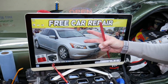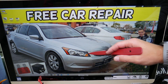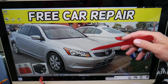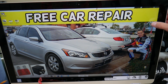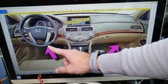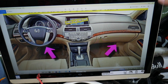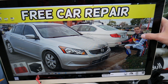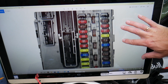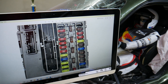For the immobilizer, you actually have two different fuses in two different fuse boxes. Fun fact: this Honda Accord has three fuse boxes total, but we'll work in just two of them. We'll demonstrate on a 2010 model. The first fuse box is inside the vehicle on the driver's side — look upside down under the dash, above the pedals, and you'll see a fuse box layout that looks just like this one right here.